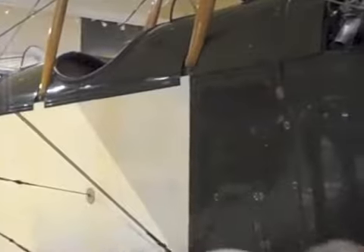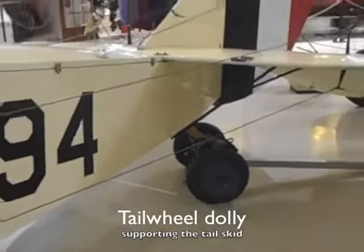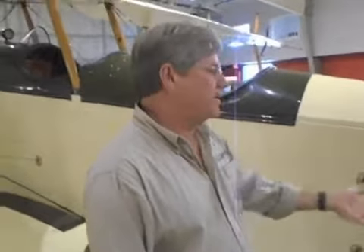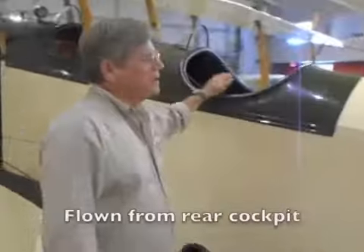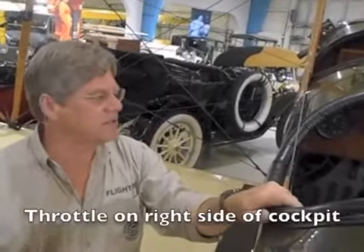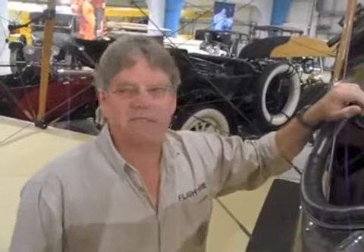Let's go around to the cockpit and look inside. When we take it out, we're rolling it out, towing it with a tractor or with a large crew. We lift the tail off the dolly — this one isn't very heavy, it weighs a couple hundred pounds, maybe. We usually have four guys back here, or two guys lifting and a third pulling. You fly this one from the rear, and the first thing a pilot will notice is this is a left-handed airplane, which is odd. The throttle's on the right. Most of the time when you fly a stick, you fly with your left hand on the throttle and your right hand on the stick. This one's set up exactly backwards.